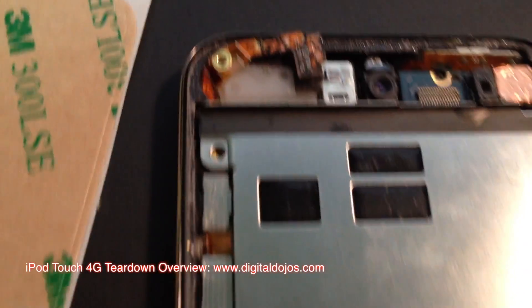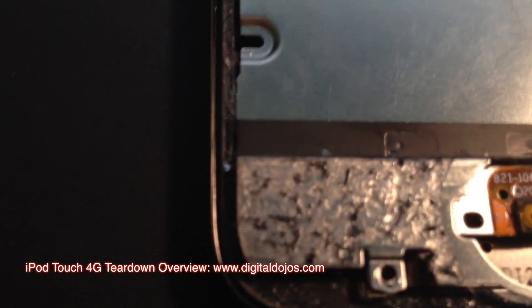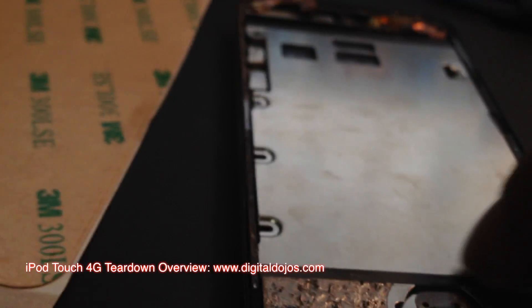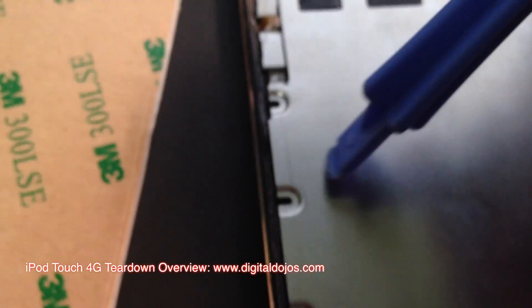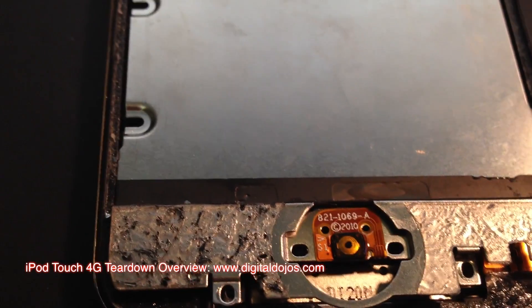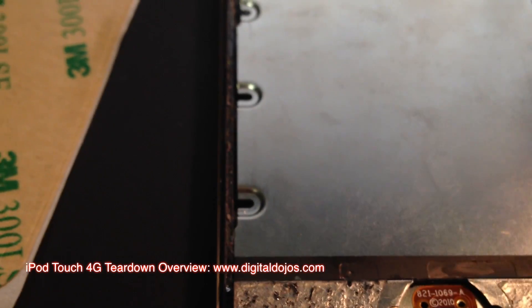By default you'll have this metal plate on, which protects the connectors and motherboard. You'll notice all these little chips are from broken glass from the old screen when I took it off. When you take the screen off, make sure you get all the screws off. Unlike older iPod or iPhone generations, there are no screws in the bottom of this iPod — the screws are all inside. You'll need a Phillips head, I believe a zero head. You can get a toolkit from iFixit, and I believe Parts4ipods also has some iPod opening pry tools.